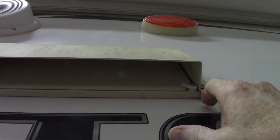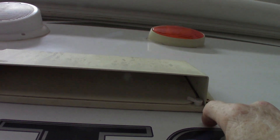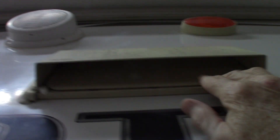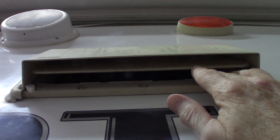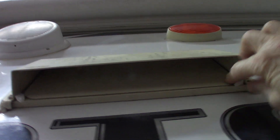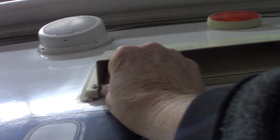This is just power here. This is your furnace vent here, outdoor speakers, and this vent here is for the range hood fan. So if you're going to be venting to the outside you have to move these tabs down so this baffle flaps freely. If you're not using the range hood vent, you shut it like this when you're traveling or in storage.